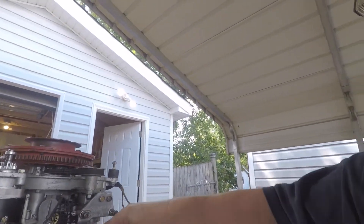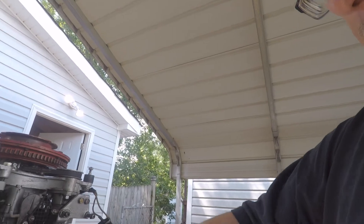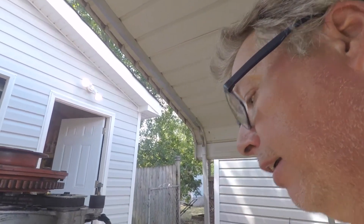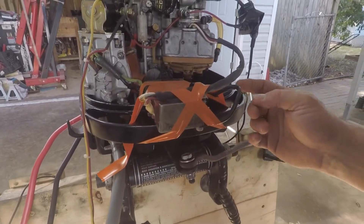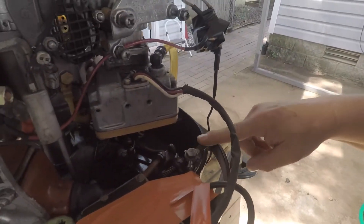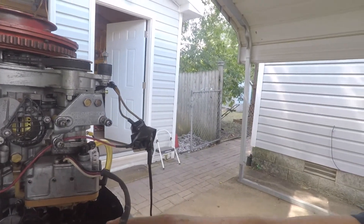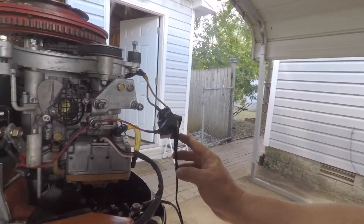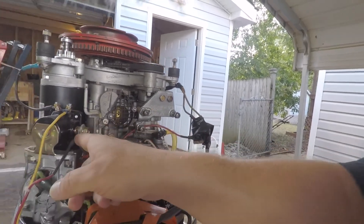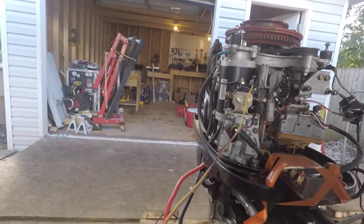Just to refresh — you've got your coil, it goes into the switch box, and then this goes to the distributor. I taped this to the side so it's not touching anything. I have a ground wire going over to the chassis, and then a cable going from the chassis to ground on my rectifier so it's still rectifying the voltage. Everything's hooked back up and I've got my remote switch ready.